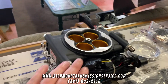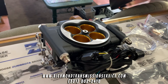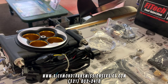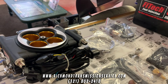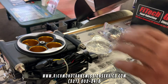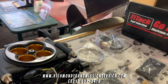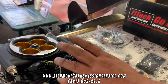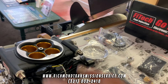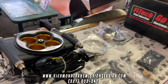This unit right here — how much is it with your price and installation on, say, a small block 350? Small block 350 installation is very subjective. You're also going to need some sort of a fuel source. FiTech also has an external inline pump — these don't run at the same pressures that sequential injection does. These run more like the GM style, under 50 PSI in most cases for street applications. Depending on the system you buy, they're as little as $850, and this one hovers around $1,500, which I think is a great deal for something that is really a swap in a box.